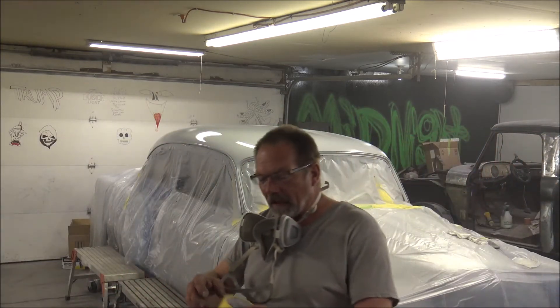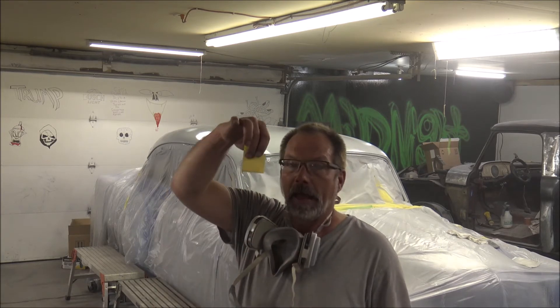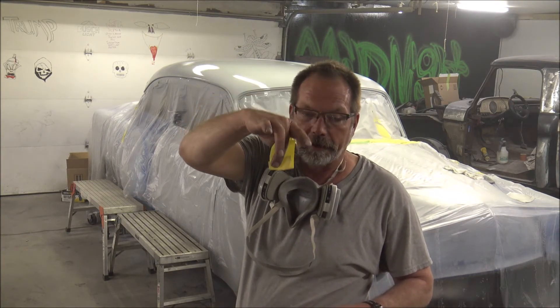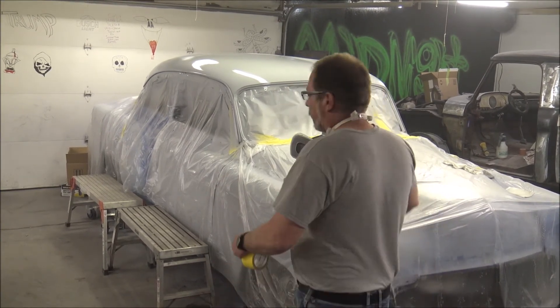So the Harbor Freight paint gun does have a flaw. The needle doesn't close tight in the nozzle, and it drips. So as soon as you let off the trigger, the needle isn't sealing tight and it continued to drip. Didn't realize that as soon as I reached the gun over the car, down came a drop. What you can do to remove a droplet or a run: take a piece of two-inch tape and just dab it down, remove some of the material, then roll the tape a little more so you have a clean spot, dab it down, pick up more material. Just keep rolling it and dab it down, and you can get it down to where you can't even notice it. We put another coat over the top of it, and you've got to look pretty hard to find it. That's my tip of the day.